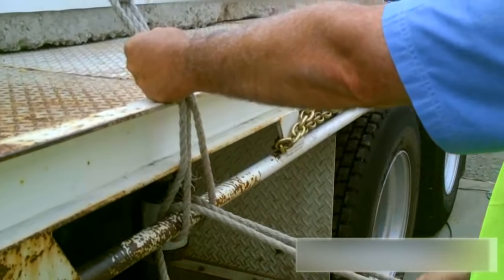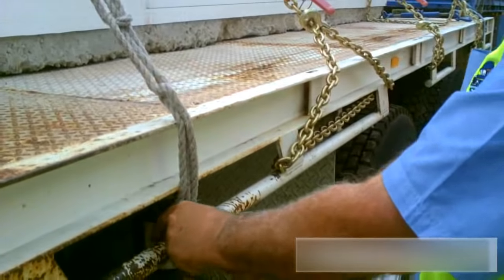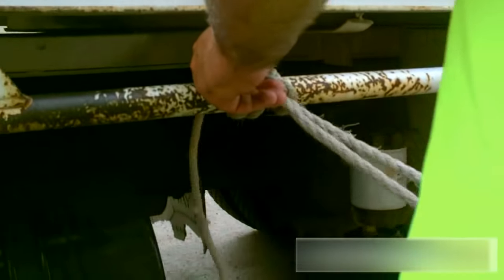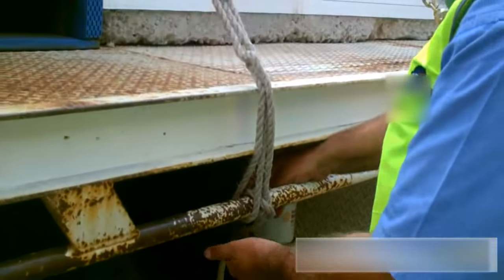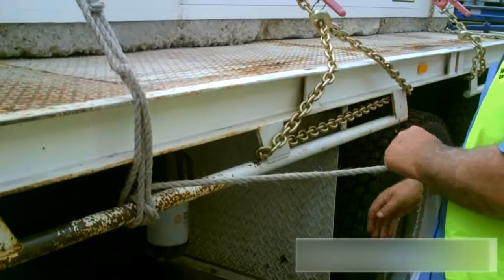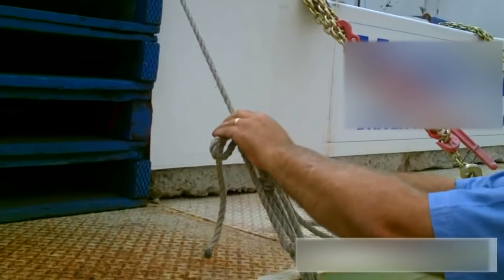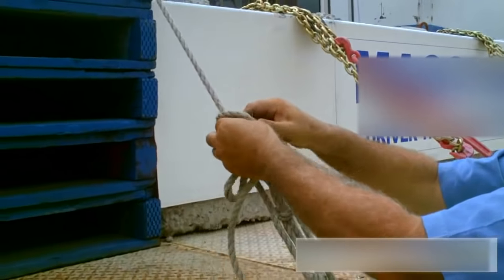Thumb above the rail, pull the rope into the handle. Move the rope in close, pull it tight, pinch and complete the clove hitch, pulling down tight. The rope comes up here and we have to lose all the loose rope. A lot of people will secure it along the rail, but it's probably best to secure it high with a half hitch above the knot, so that it's not dragging around on the road. No more than 100mm tails.